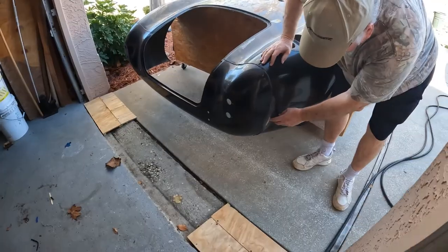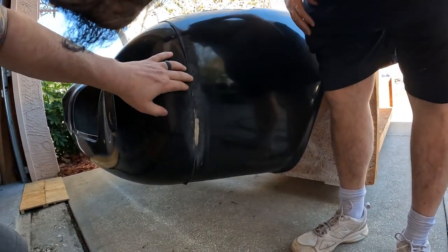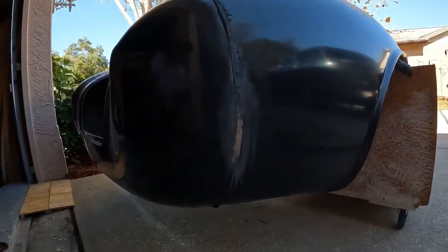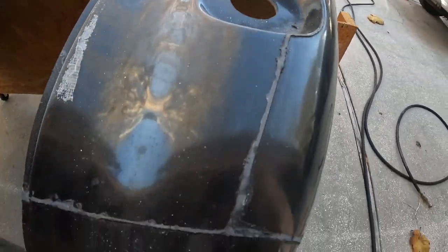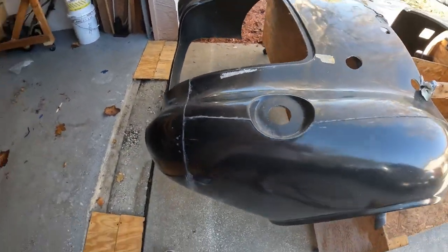Okay. Here's the white stuff, the regular, and I took the gel coat off, and then I cut this seam out with a grinder, just to see, you know, to play with it. Let me get my light, my back light. And you'll see it. You don't want to cut that underneath because you want to bond that together. So this is the seam that we're trying to... So I cut too much out. I didn't V it, but I was trying to get all of it out. Prep this thing. All right, well, let's just start chewing it out and see what happens. Step one, here we go.